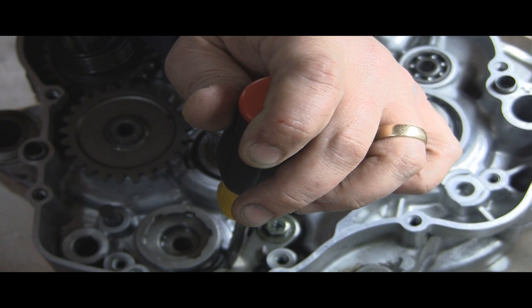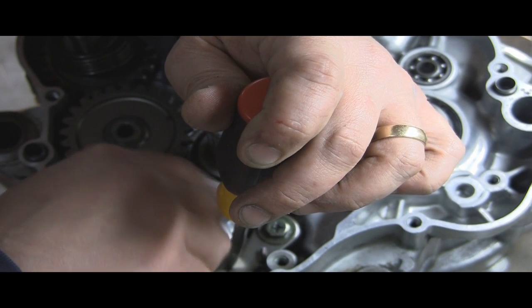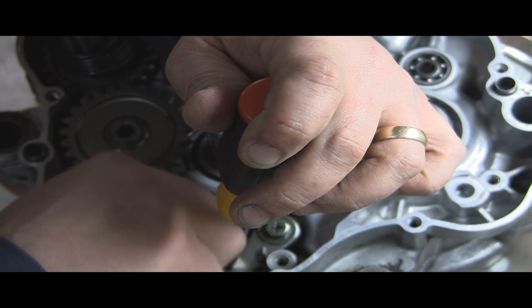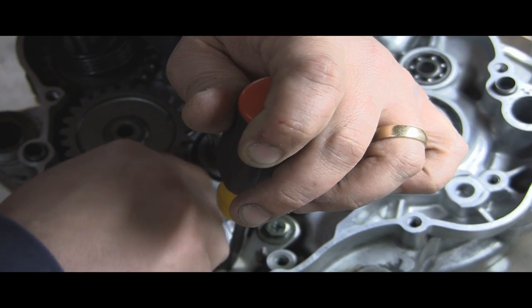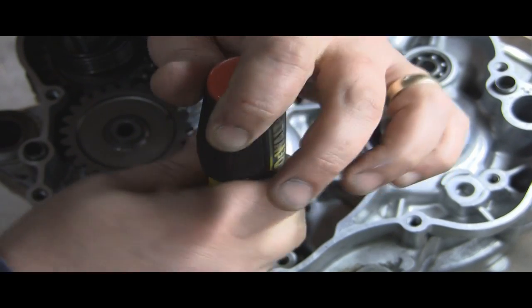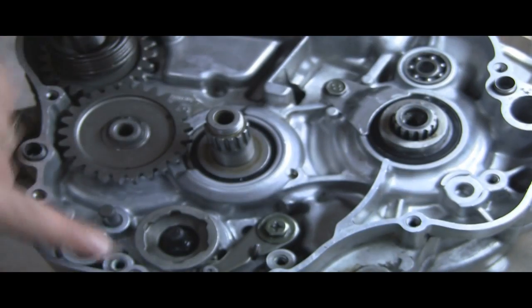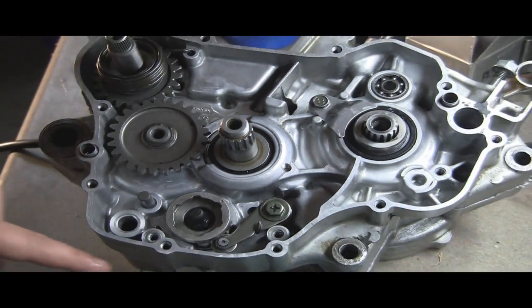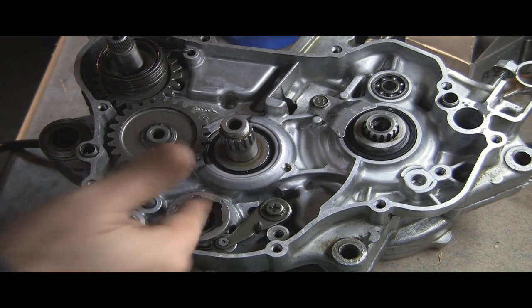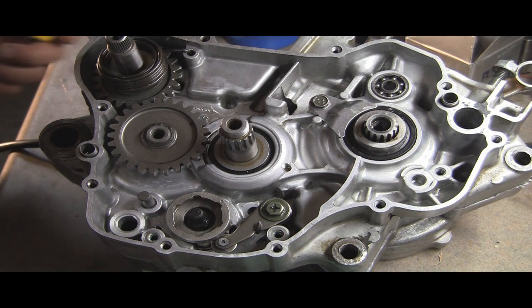screw in there, our nut right here, and we'll end up torquing that down. I think it's about 10 foot-pounds also. We can take our screwdriver out, there you go, and that little wheel rides on the inside of that, or on the outside I should say, of that little drum there. So that part's done. We'll go ahead and crank this down, and then we'll move to the next step, so stay tuned.